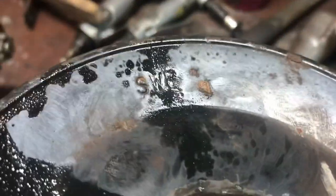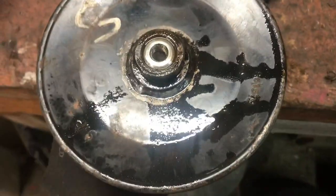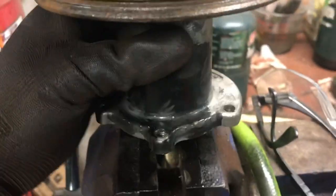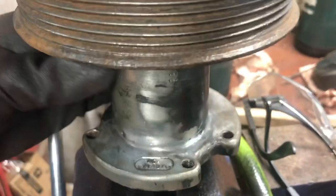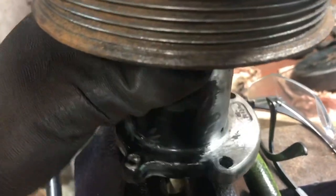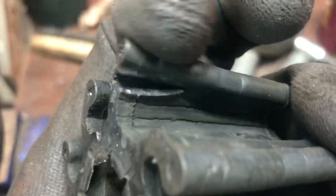Here's the main seawater pump — it's got initials SWP for seawater pump. I just squirted some PB Blaster on this. I'm going to be pressing this pulley out because it sounds awfully crunchy, so the bearings definitely need to get replaced. There's a little drain hole in the bottom — probably where water drains out. Here's the old seawater pump impeller — it's got all these cracks, definitely worn even on all the fins. This was ready to fail.